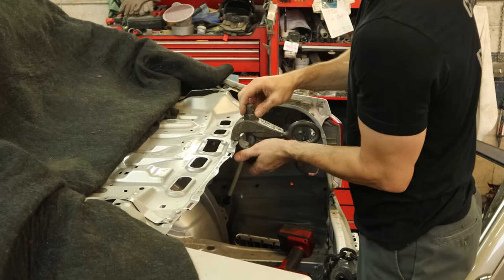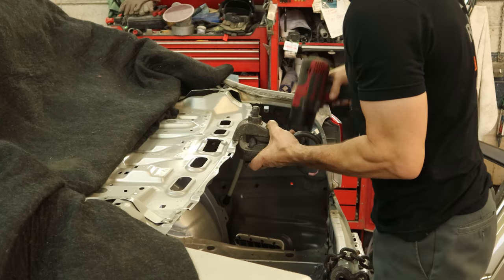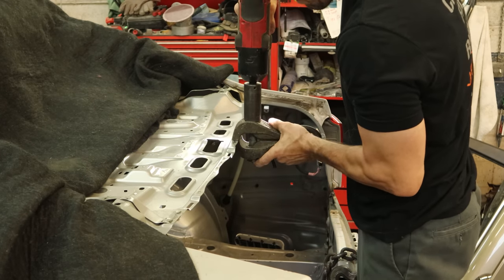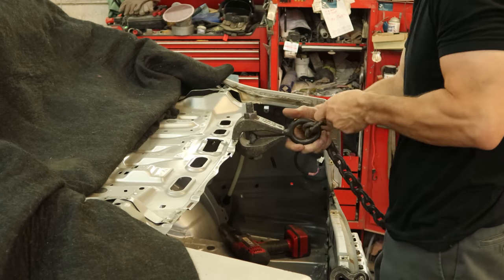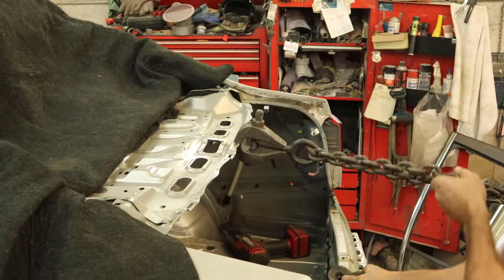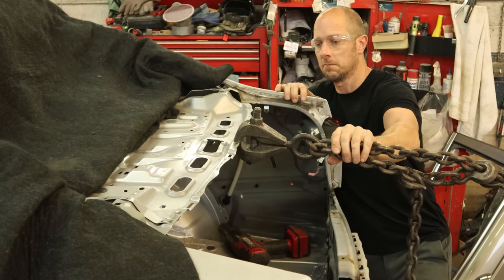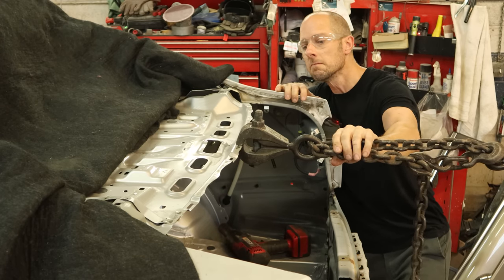I did leave the car up on the frame rack and clamped down, just because I need to pull this little part. It's pretty fragile so we're gonna have to hold the clamp while we clamp it up. If I let the clamp just hang on there it will bend that piece — it's pretty flimsy. We're just gonna put a little bit of tension on it, trying to get that roll out of it, putting the right bends back in and hammering out the wrong ones.